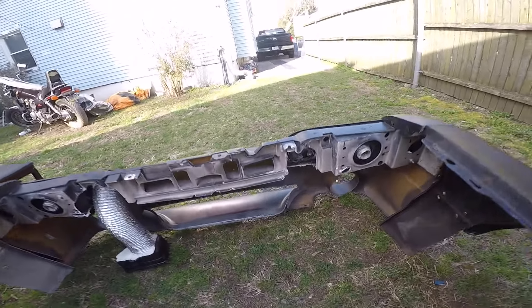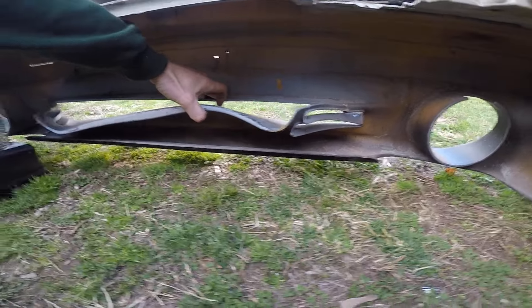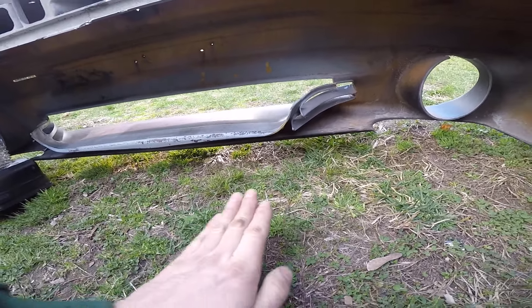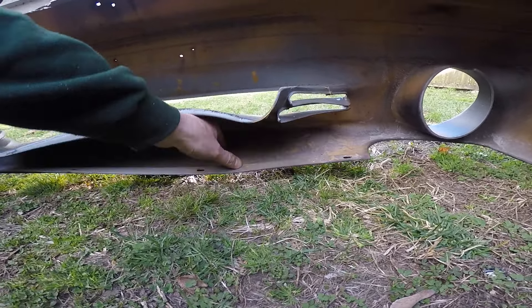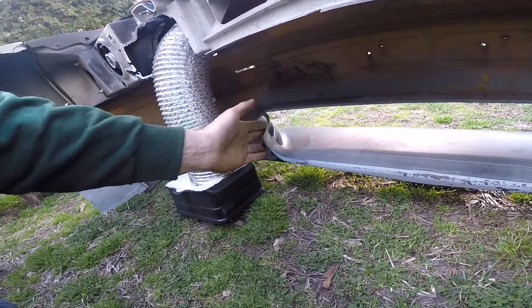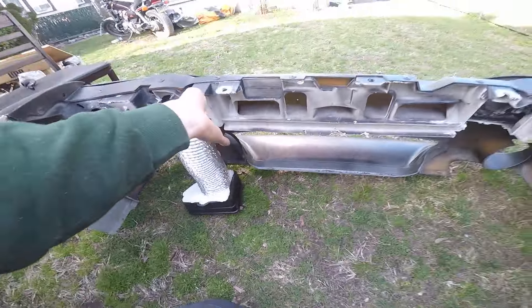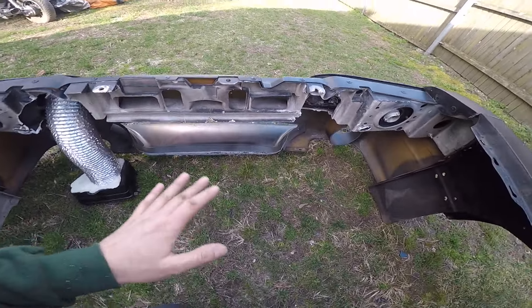This is a GT nose, GT front bumper, so we've got some area. That piece of aluminum that comes out, I usually slide it right into this pocket — it doesn't have to be perfect, it can have some adjustability. As long as it sits in this pocket, the airflow comes in through here, right through the radiator. This is why I tape up these decorative pieces — you want to funnel that air through your radiator.